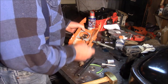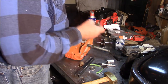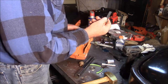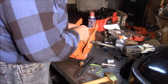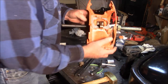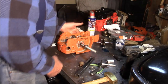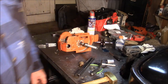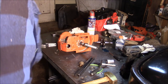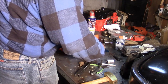So to be honest with you, when I get that same kind of feel both sides, by stepping down until when I tap on the one side and it snugs up against the feeler gauge, I can take that feeler gauge and do a slip fit on both sides of the crank. Visually it looks good. That's good enough. I got roughly 19 or 20 thousandths a side on both sides. You're not going to get it any more centered than that where it matters. That's pretty much all you got to do.